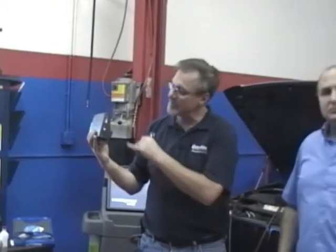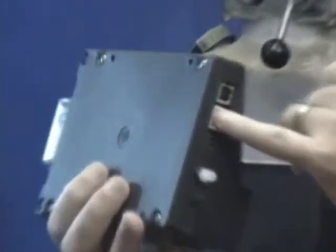Everything now is going to be done through a USB connection. We've got a power port and a serial port - it's all AES-256 encryption. Why? That wasn't our idea - that was the idea of the standards people because they said we want to make sure nobody can take a USB stick and buy one off the internet that automatically bypasses the refrigerant analyzer test on an AC service machine. They wanted to make sure that connection was secure and required a valid refrigerant analyzer pass signal before it was allowed to continue.